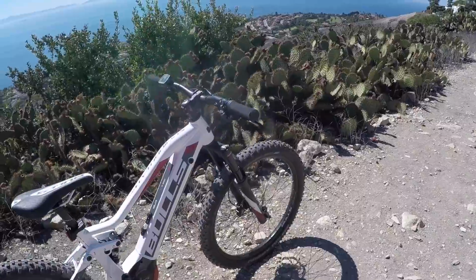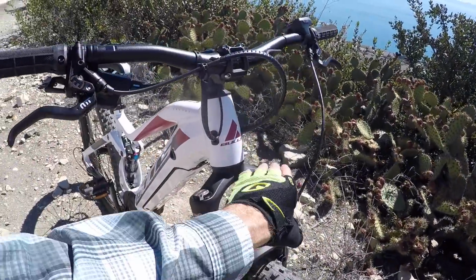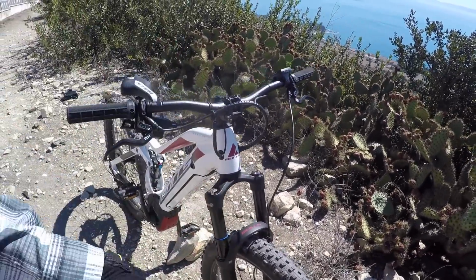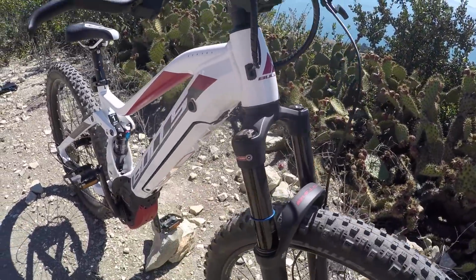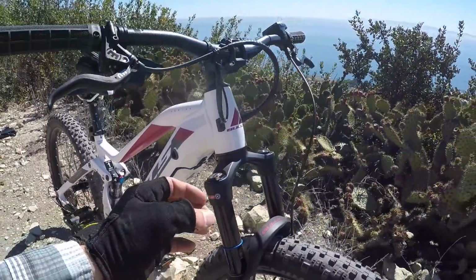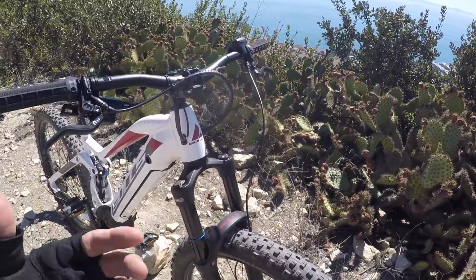I'm a big fan of suspension, especially air suspension, a little bit lighter weight, more highly adjustable. You can sag this if you're someone who doesn't weigh a whole lot and you wanna kind of loosen it a little bit and experience all of that travel. I'm only 135 pounds, so I sort of fit into that spectrum, but the reverse is also true. If you weigh a little bit more, you can raise that air pressure and dial things in. I love that they've got this black anodized coating on both the suspension fork and the rear suspension. It looks nice, but it's also a little bit tougher if rocks hit it or whatever, and it's supposed to slide really efficiently and not have as much stiction.